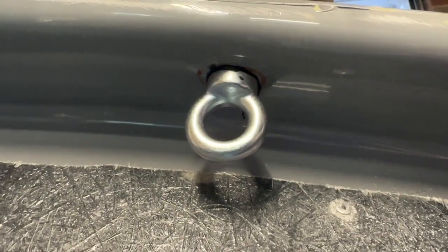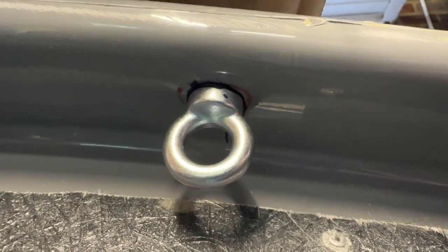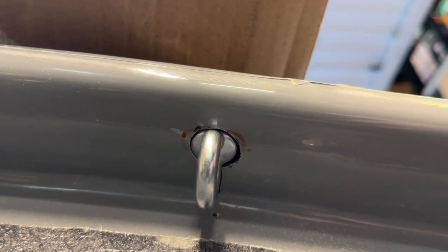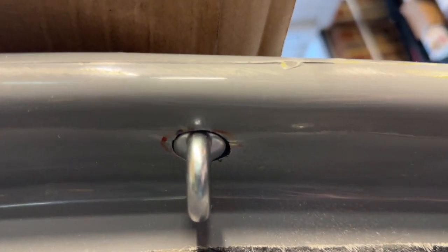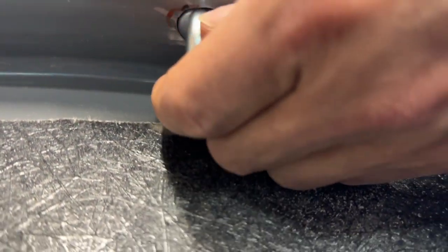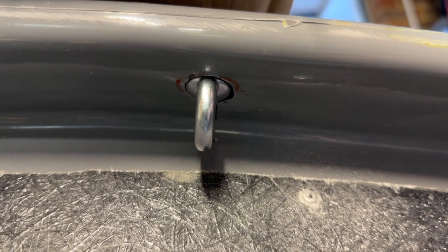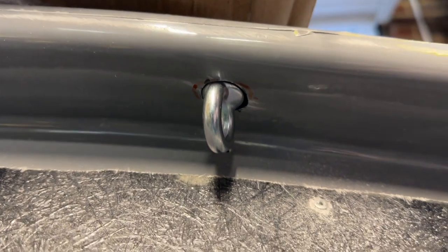I've got my shortened bolt and I've just screwed it up to the body and made a little circle around it so we can get a nice accurate neat circle cut out. That's the completed job for now — the body isn't on permanently yet because I've still got to fit the engine, so there might be some movement and I'll probably add another couple of mil. Make sure the bolt length doesn't hit the top of the body. You want the bolt finishing its tightness in roughly the right direction so the harness can be attached — you might need a small shim or washer to achieve that.